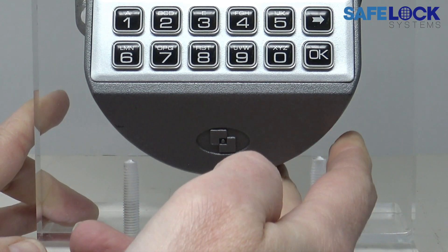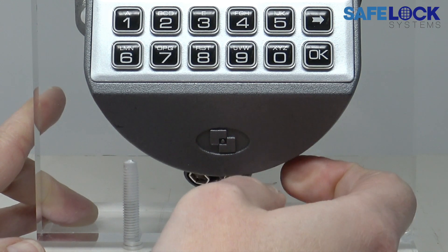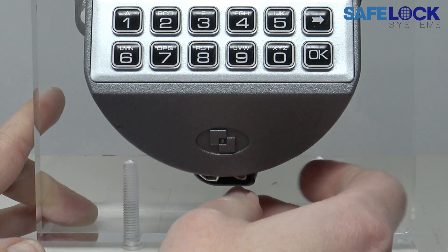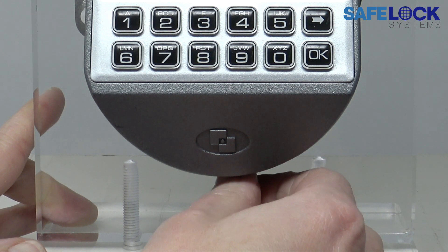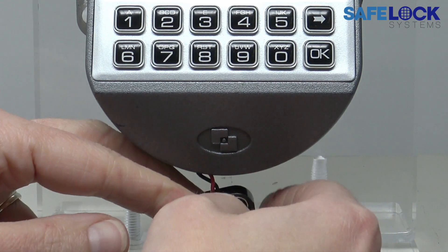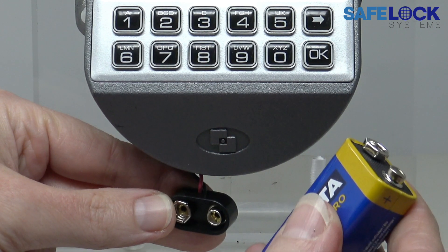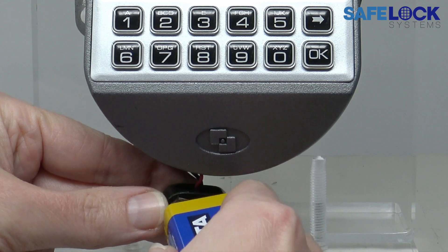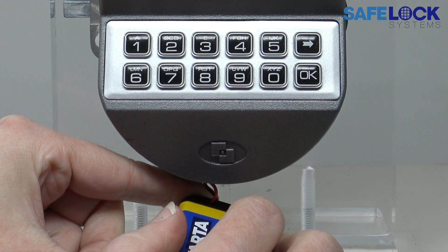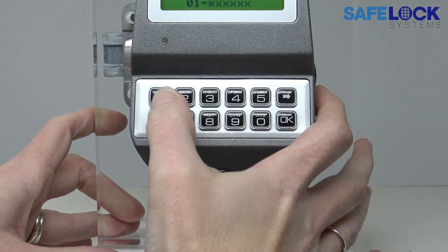You can see here that the battery connectors are free. Sometimes they're quite deeply stored within the compartment, so it's a bit more difficult to get them out. It might be necessary to very gently use a pair of tweezers or needle nose pliers to pull that out. Don't pull on it too hard to avoid the risk of breaking the cables, and then connect a 9 volt battery so that a code can then be entered and the lock can be opened to then access the battery box.